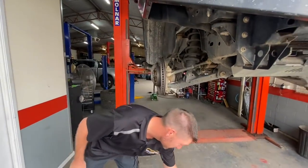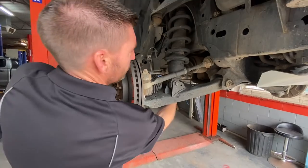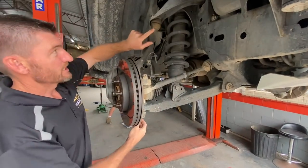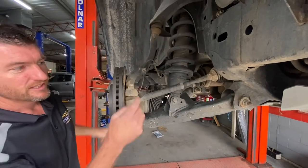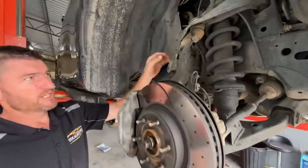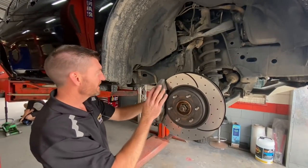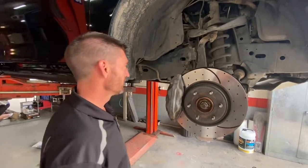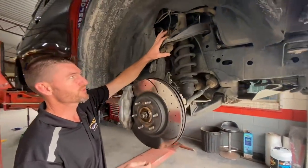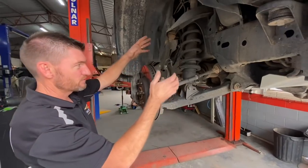For the lower control arm, loosen the lower strut bolt - just loosen it for now. The nut up here for the upper control arm, undo that. You've got split pins and a tie rod, so definitely undo all three. There's a little nut on the brake line - you don't need to undo the whole brace, just one nut to move the flexi line out of the way. Undo the caliper and hang it up so it's not pulling on the flexi hose. Remove the disc to take some weight away, then you can start cracking your ball joints - leave the nut slightly loose so it doesn't fly up.